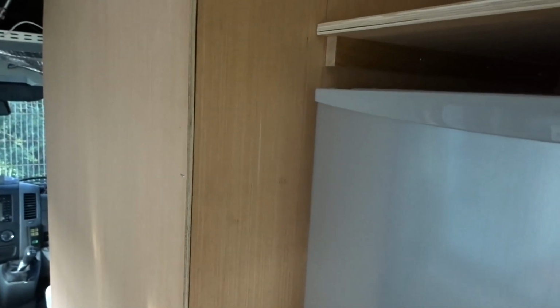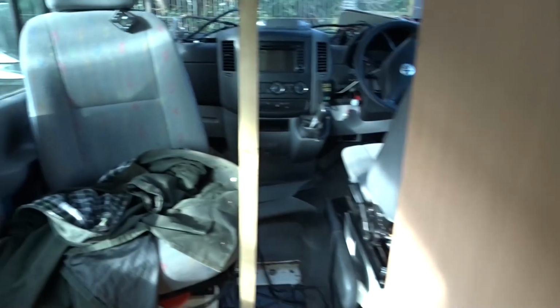The shower room itself, I've just framed it out, and I've used a piece of plywood with the edge square, both corners, simply to make sure that the sides behind the seat, that bulkhead there, or the part of the bulkhead there, the side behind there and this side here, obviously this wall here, are square to the floor, because there's nothing really to take any measurements from in a camper van for squareness. So it's what really has to look right to the eye, and because this unit is going to be virtually the first thing you see when you come in the door, I wanted the sides to look square.